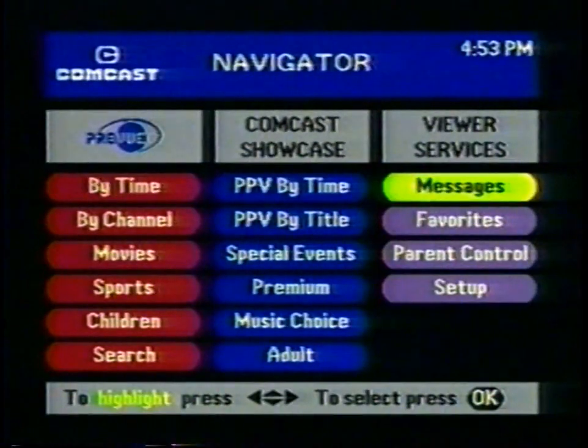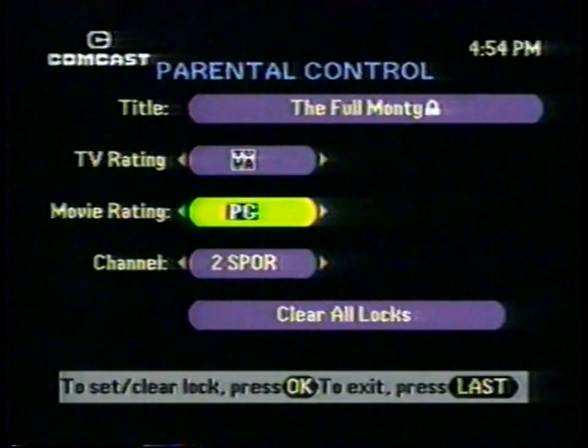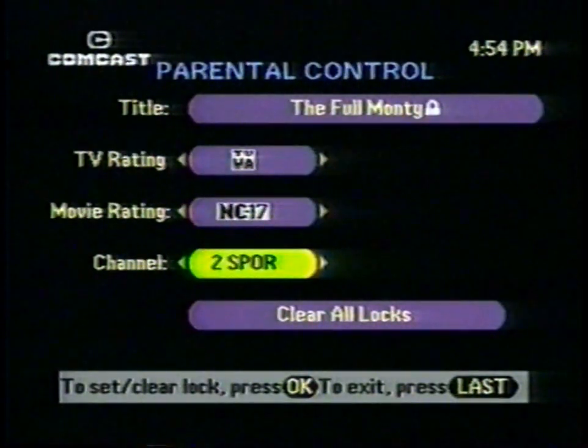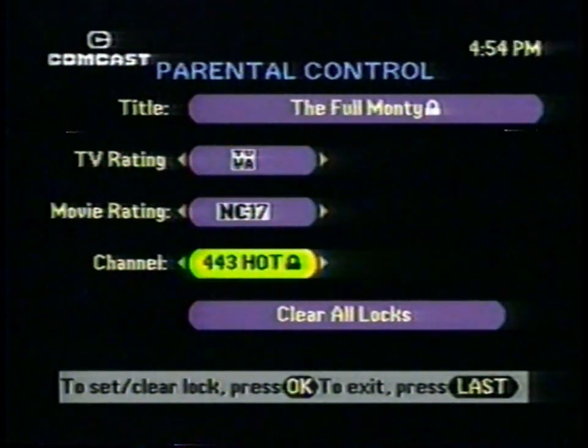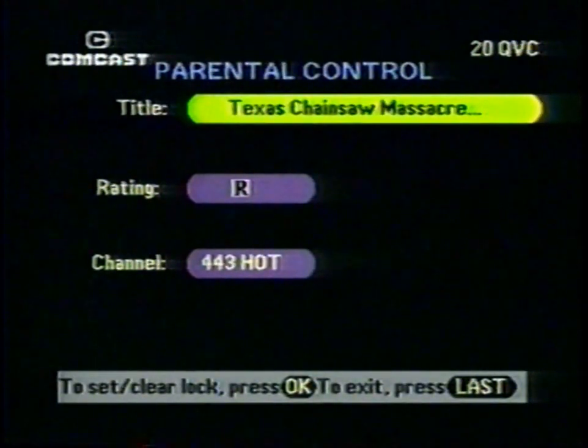You can also customize your digital cable to block certain programs. You may want to control access to some or all of the pay-per-view selections — no one can see anything you don't want them to see. Go to the third column and choose Parental Control. You'll be asked to come up with a code number and enter it. From then on, anyone trying to watch that locked program will have to enter the same code. Fill in all the program categories you want to lock — you can block all programs with certain ratings, choose movie ratings or TV ratings, or block out certain channels. Specify what you want to block and press the lock button in the compartment on your remote. Or you can block any program individually by highlighting the program and pressing the lock button.